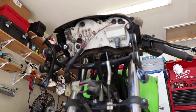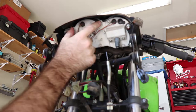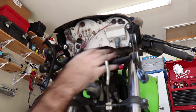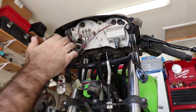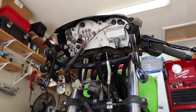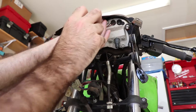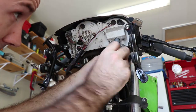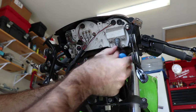While I was waiting for the penetrating oil to do its thing, I looked at this a little closer. I'm going to save you some trouble: this shroud is held on by four screws — two here and two here. So I'm going to go ahead and remove those and see if I can just get the shroud off. These are regular-size Phillips screws that mercifully come right out. You could make this easier on yourself by using a longer screwdriver, but I'm using a stubby one.